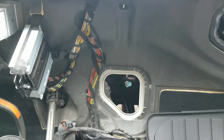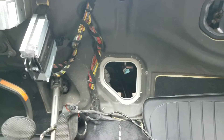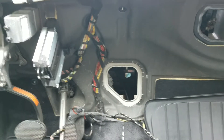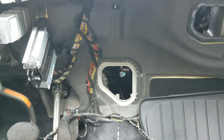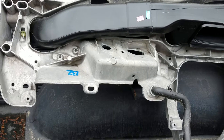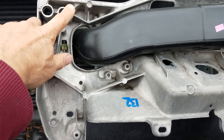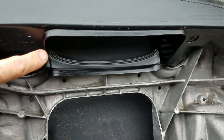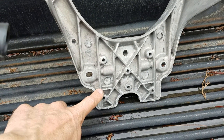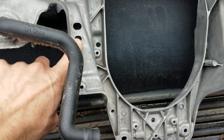There are some holes where there are plastic pins on the air box that fit into the structure — that's really what holds it in here. Then there's another plastic structure where pretty much your gauge cluster and those things screw into, and of course you have the dash pad. Here's the crash structure — it's backwards here but that's where your bolts go in, there's the locating pin, same thing on that side. Right here are your air conditioning vents — the box comes out and feeds all four vents.